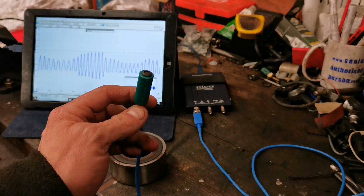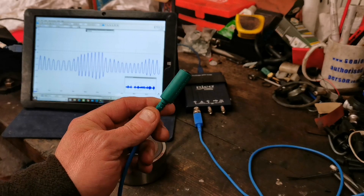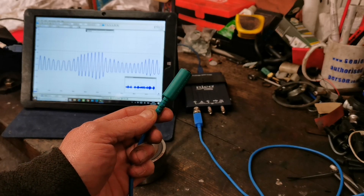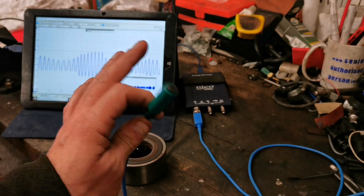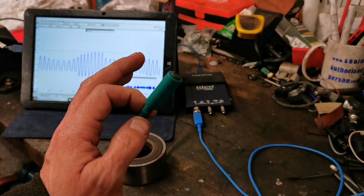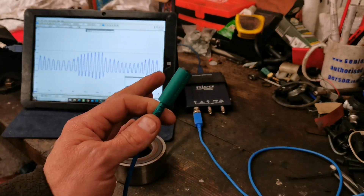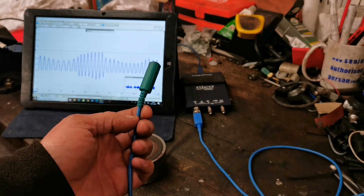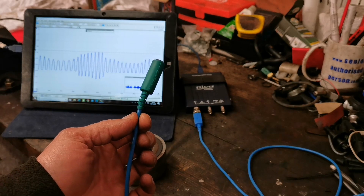In the near future I might do a video a bit more on AC ripple - I've seen a couple of videos on YouTube where guys were having problems and discovering false readings from multimeters. I might expand on that. Using this tool here we can see AC ripple, but that'll only work on some alternators - if the rectifier isn't at the back of the alternator you're not going to see it. So if you don't see AC ripple using this tool it may be because of the type of alternator - just a wee disclaimer. Anyway, thanks for watching, hope you get something out of it, all the best and bye.